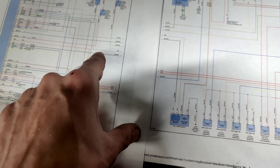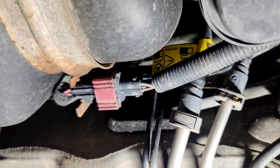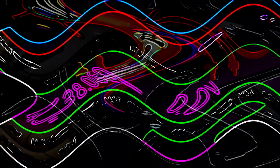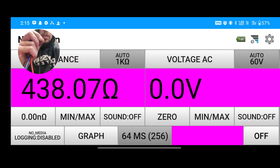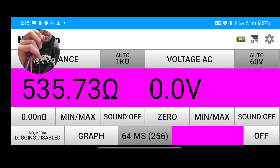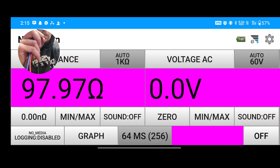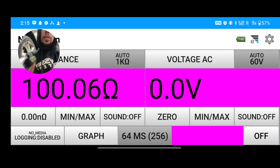The gray and black wires come up here to this connector, but I think they change color somewhere on the car. I'm going to use this potentiometer and dial it in. I'll turn the dial until we get down to around 100 ohms — I can't remember the exact range for this car. I think you have to cycle the key every time. Okay, we're set at 100 ohms, so I'm going to probe this into the car.